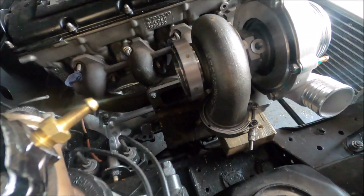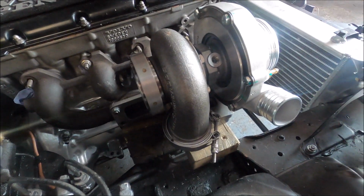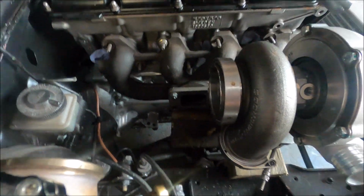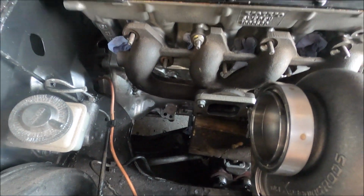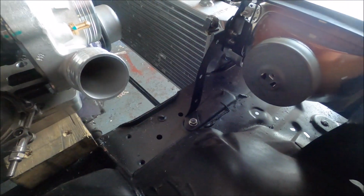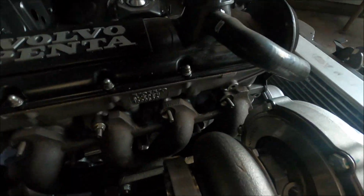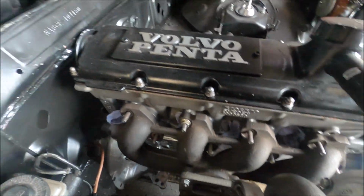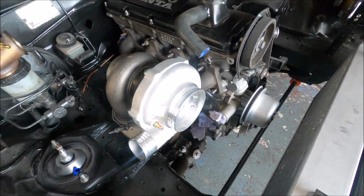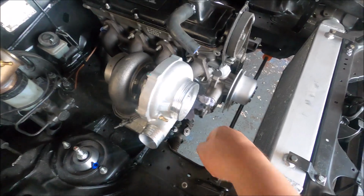Basically that allows for an easy link pipe from the exhaust manifold to the turbine inlet. It allows plenty of room for a downpipe. It allows plenty of room for the boost pipe to the intercooler inlet. It allows plug clearance, and it allows room for an air filter, which will likely be off at 90 and facing down.